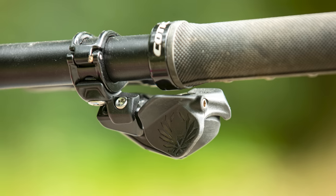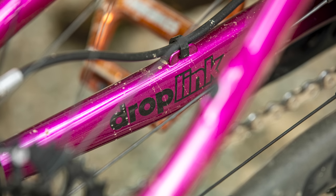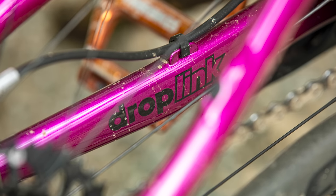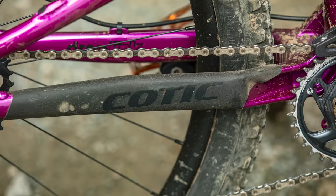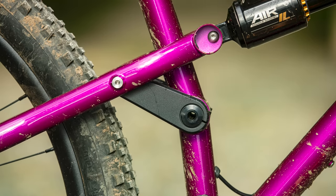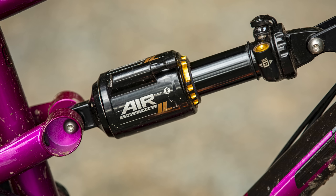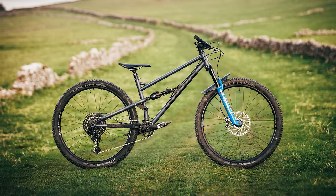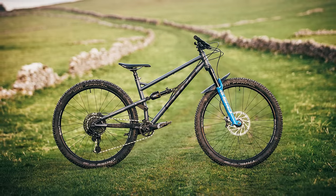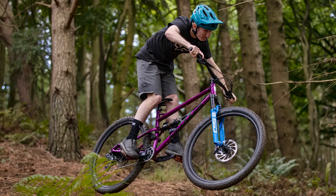The Flare Max is now in its fourth generation and the most recent updates saw the steel and aluminium frame use their drop-link suspension kinematic first introduced on the Jet. Cotic claims this keeps the progression curve more consistent through its travel. The updated pivot location gives 20mm more space for longer dropper seat posts and allows the use of the more common metric size 210x50mm shocks. The proven long shot geometry remains largely unchanged, with a slack 66-degree head angle and steep 76-degree seat angle when fitted with the 120mm fork.